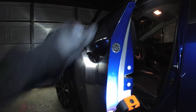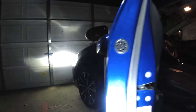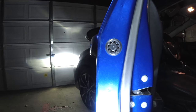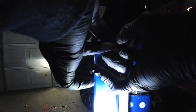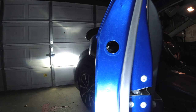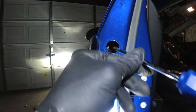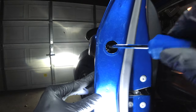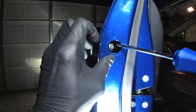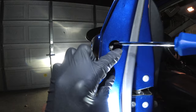On the back of the door, there's a little plastic plug which we have to remove. Then go in there — there's a screw right inside, it's a T25 Torx. Get in there and loosen it all the way out. There are little retaining tabs back there that prevent it from dropping down inside, so make sure it's fully out.